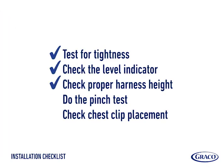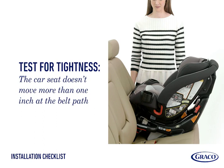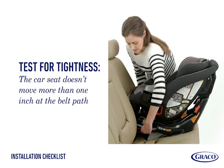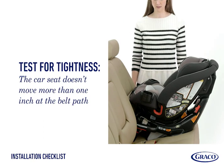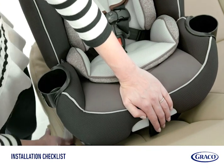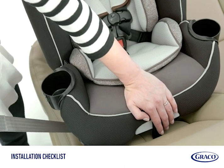Finally, go through this checklist to make sure the installation is correct. Test for tightness. Grab the sides of the seat where the InRight latch strap is routed and slide the seat side to side and front to back. The seat shouldn't move more than 1 inch in any direction. If the seat moves more than 1 inch, pull on the latch strap to remove slack. Repeat until the seat moves less than 1 inch.